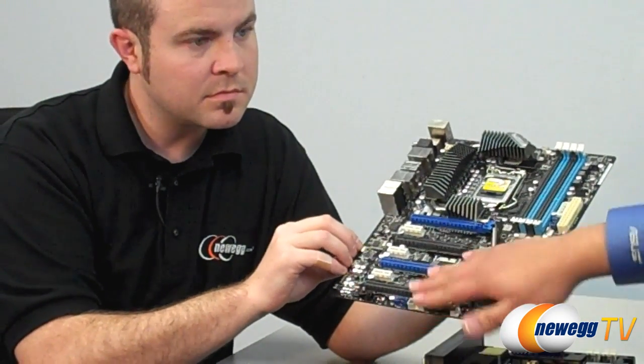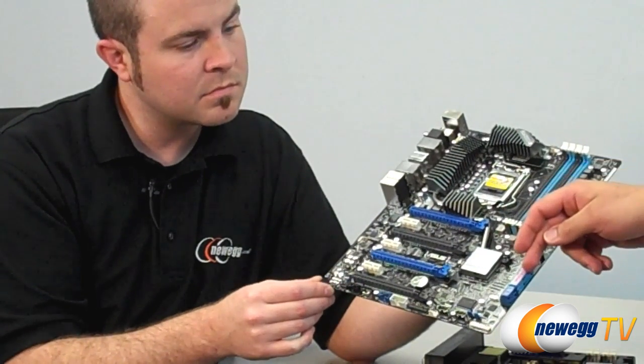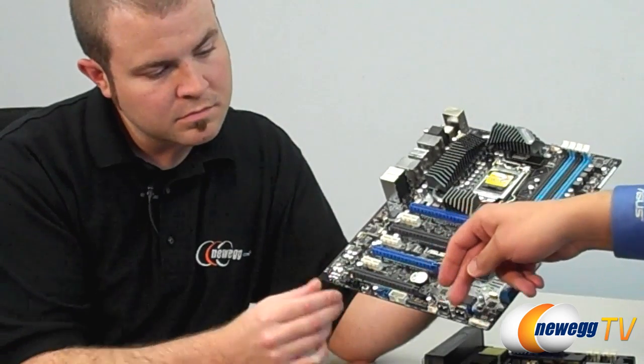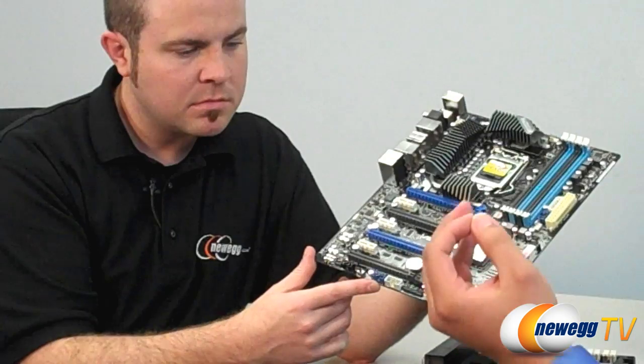This is a really GPU-friendly board. You've got four PCIe x16 physical slots, and you can run full three-way SLI support. It's a really robust board for multi-GPU computing. We also maintain UEFI BIOS support and digital VRM, USB 3 on the front and back, and all right-angle connectivity. For this workstation environment, there are also raised internal USB ports, specifically requested by users running software like 3D Studio Max or Maya that require dongles — some of which are very expensive — keeping them secure inside the system.